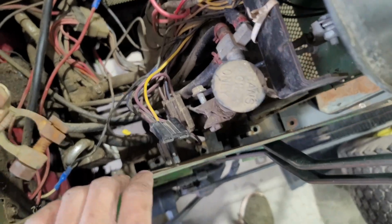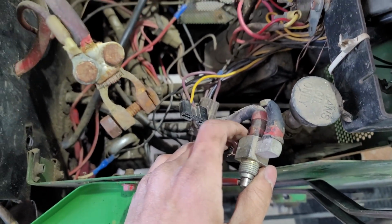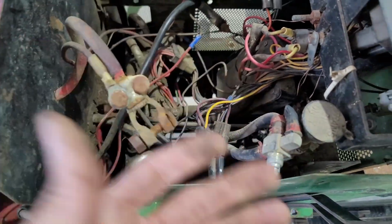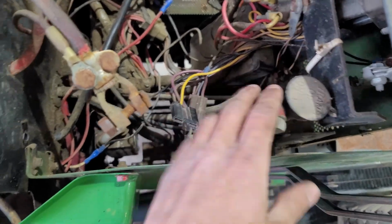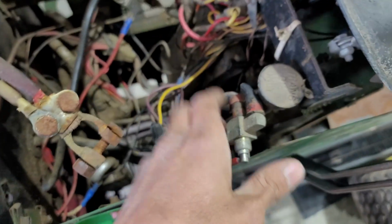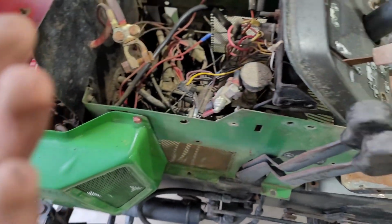So we're replacing the fuel lines, all the fuel lines running to this. I need about 10 feet of quarter inch gas line, which I think I could get from O'Reilly's or AutoZone or something. Run the line back to here, run the line from the fuel pump to the carburetor, run the two lines to the back here in the gas tank, get the fuel pickups, clean the gas can out, and we should pretty much be in action.